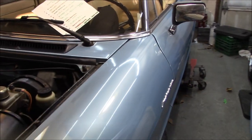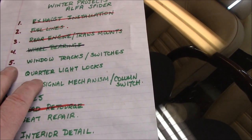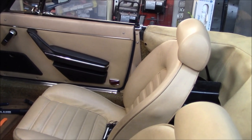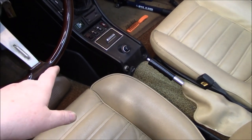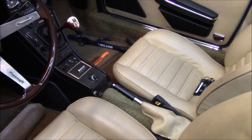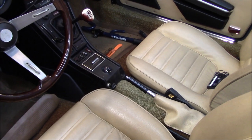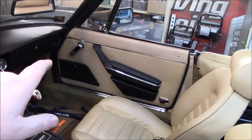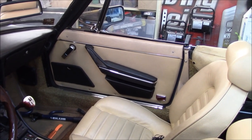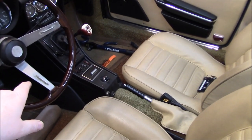Let's move on to another project. As I mentioned yesterday, the next project was going to be number five on the list: the window tracks and switches for the power windows. I don't believe the door panels have ever been off on this car, so I thought it might be good after four years to get in there and lube the mechanism that works the power windows. The power windows are a little bit intermittent - I don't really think it's the inner workings of the door or the motor. I believe it's just the switch contacts that need to be cleaned. Since this car hasn't really been driven for the last 15 years or so, those contacts could probably use a good cleaning. We're going to do a little bit of preemptive maintenance - take that door panel off, lube those tracks and the mechanism, and then go after cleaning the switches.